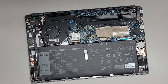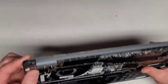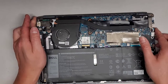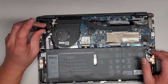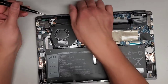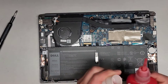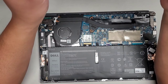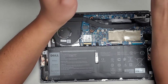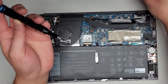I'm going to have to dust it out — it's a little bit dusty. We're just going to do a quick look in here, because the main thing I need to fix is the hinge. The thing that holds the screw is actually broken and gone, so I can't really do anything about that. Hopefully these two screws remaining are going to be strong enough to keep the thing from breaking more in the future. It might help to add some thread locker here to keep that screw from coming loose, because usually what happens is these screws come loose and that's what ends up causing the hinges to break.